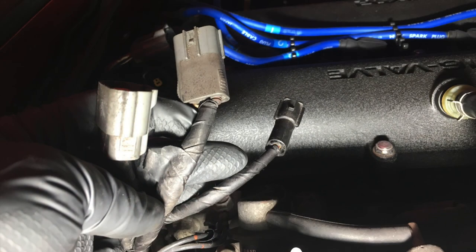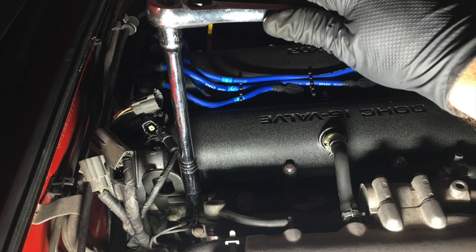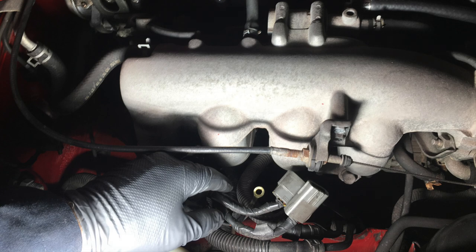You may or may not see that the plug is torn — you'll see it when you take it out. The first thing you want to do is create some accessibility to the plug. The best way to do that is to remove any plugs or wires dangling in the way. Just undo the bunch of clips here — one goes to the cam angle sensor, a couple other miscellaneous plugs. There are a couple of 10mm bolts holding down a clamp and another 10mm bolt holding down a couple of grounding wires. Undo these so you can slide everything out of the way and get a clear shot at that water plug.